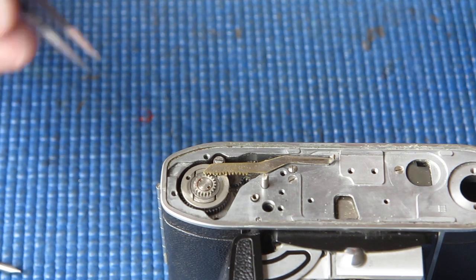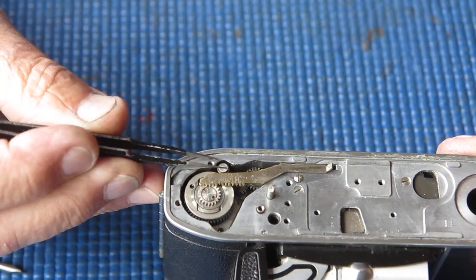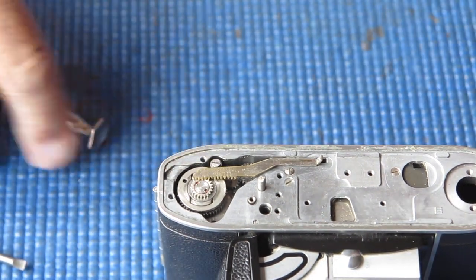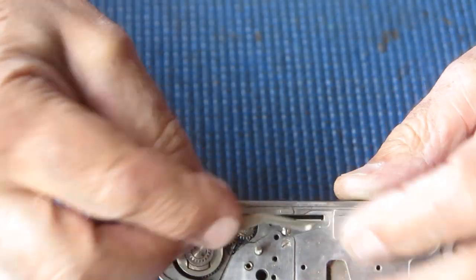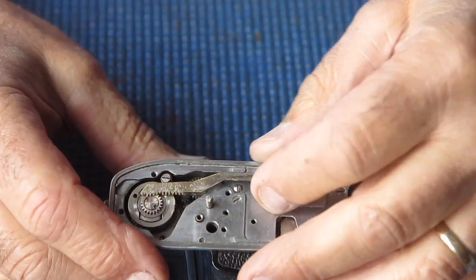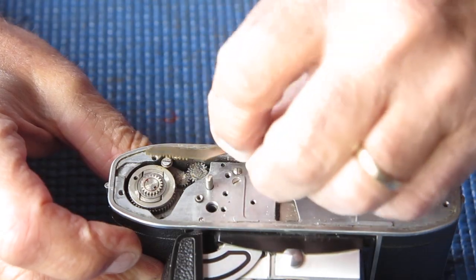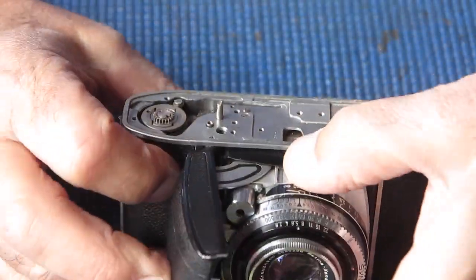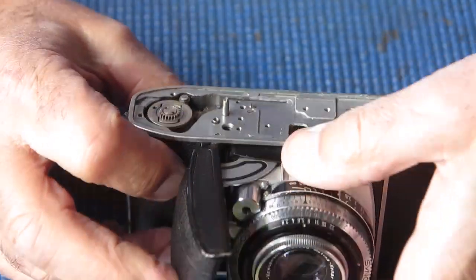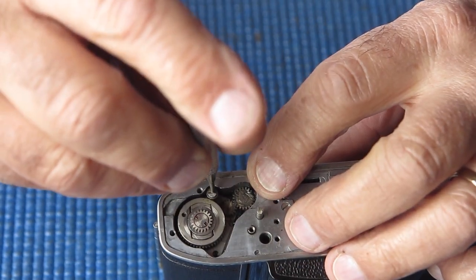A bit more information about this rack. One thing I've just noticed is that this screw here, which is the support post for the back of the rack, is loose. With the front closed, I can't actually fit the rack down in the body. That goes with what I said about this sliding section going back too far. So I'm definitely quite happy with the bent struts on the door being the root cause of the failure. This loose screw here certainly won't have helped.